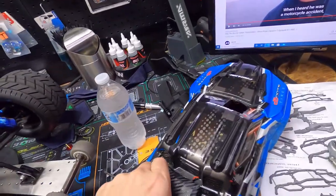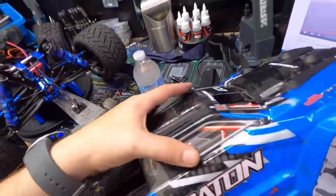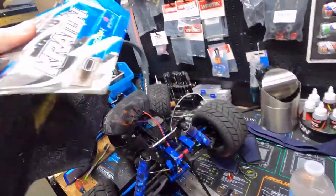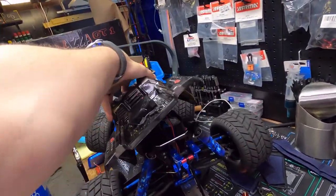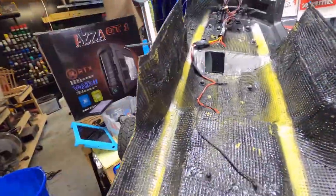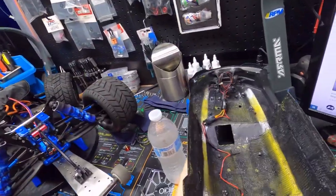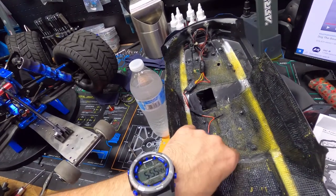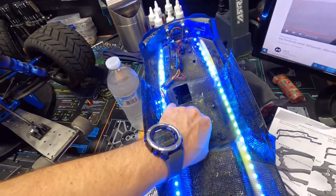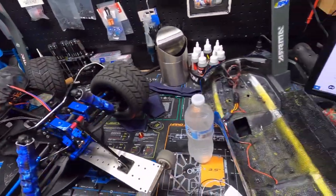Back to what I was saying — what I did is I installed a battery pack in the back of the truck. And I wired the headlights and the underbody lights all together, so that way I don't have to disconnect the wire from the truck when I pull the body off. All I got to do is pull the body off, disconnect the wiring, and turn the lights off. Makes life way easier. But I need to figure out how to splice these two things in. See, if I touch them, they come on. Yeah, and then if I touch it off, no more. So we got to figure out how to wire this into this.